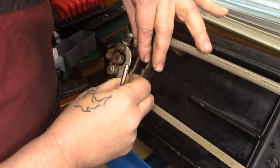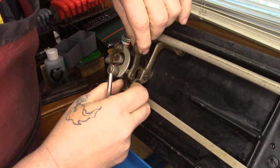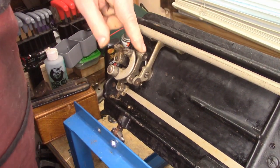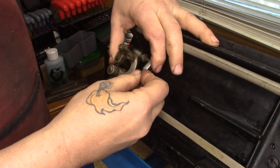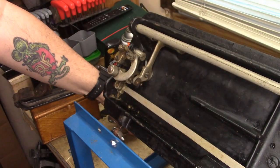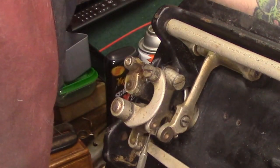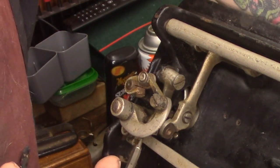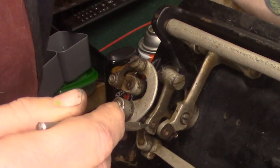I'm going to put this back in here — this machine is so filthy; I should have taken a clean machine. That's back in, so let me put the screw back on. This screw is the pivot point for the feed dog lifting arm. Now note — I'm going to turn the handwheel — this bearing does not move much. The bearing is following the cut in the bell crank; that cut in the bell crank is actually the cam. These bearings act as cam followers, and you can see the up and down motion.